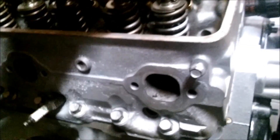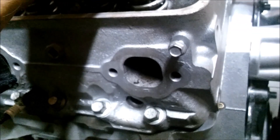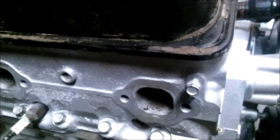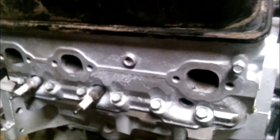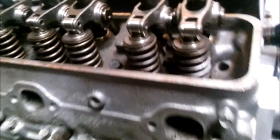That's pretty much it. I think what we're probably going to do is see if we can find shorter polylocks, because these are a little taller than I probably need. If I can't get away with the valve cover, another option is to cut around the outside of the cover and use it as a spacer, then the Vortec valve cover with its gasket would go on top. That might still not give enough clearance, and the Vortec also has little tabs to deal with. That's how far we've gotten. Done a lot of research - most shops don't give you any information. I've learned most of it off the internet, trying to ask shops a little bit.